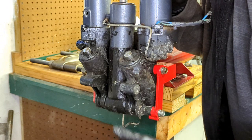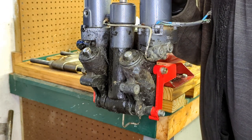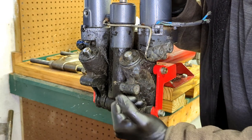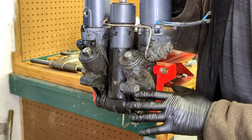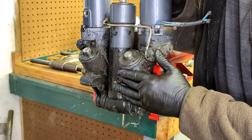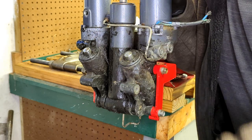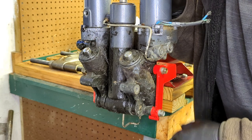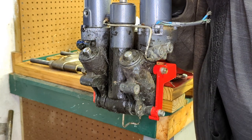When you've got units like this, I don't care whose wrench it is or what pins it is — you can easily break pins on this old crusty bottom paint stuff. You can see we've got ruined bolts in this unit already. It's pretty grizzled. So these get a little bit of love with the torch before I put a wrench on them. It will make your life a lot easier when you're repairing these. I hope that helps. If you guys have any questions, reach out to us at OutboardST.com and we'll help any way we can. Tyler Holland here — thank you.